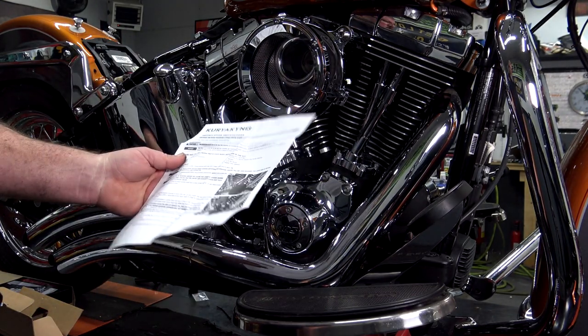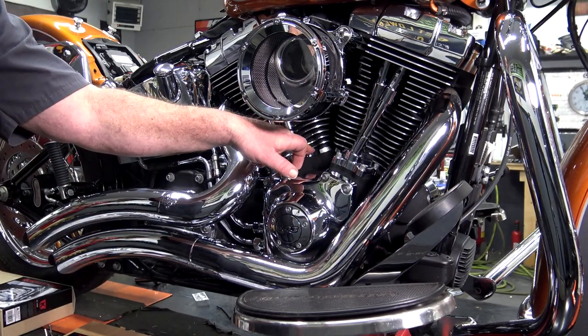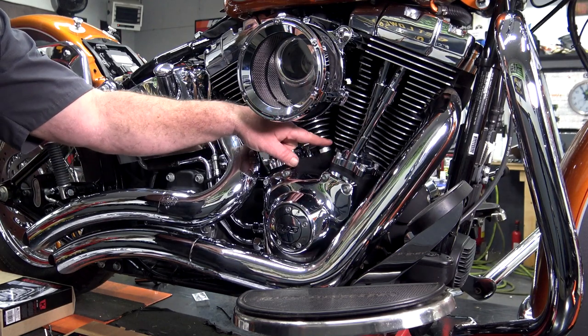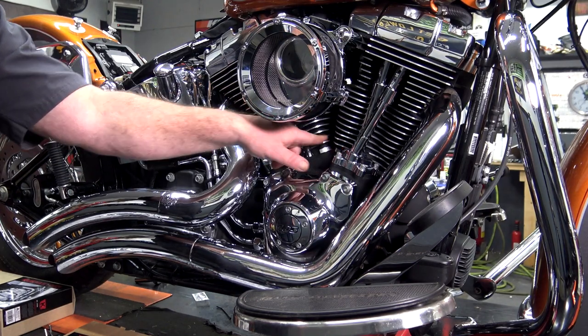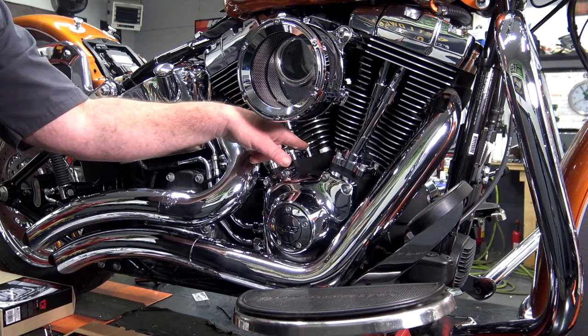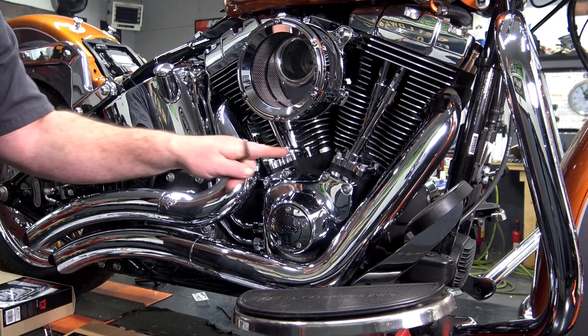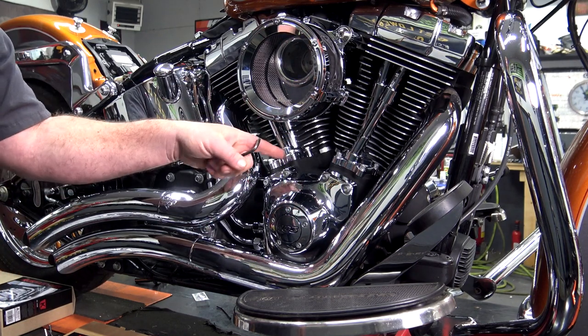It kind of looks like a lot, but it's really not — it's just a couple of bolts. Right here on the bottom of your pushrod assembly, you have four bolts on each one. The two innermost back bolts — the two big pain in the butt ones back here to get out — those are the two that we need to remove. I'm just going to take my Allen wrench because you can't get anything else in there and go ahead and get those bolts removed.